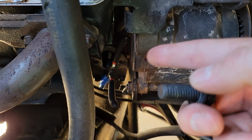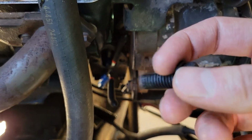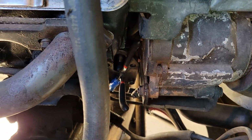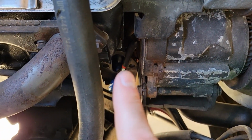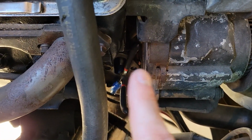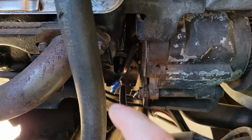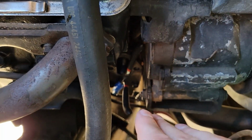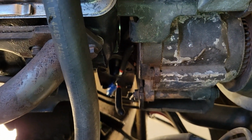It's really just best when your engine is out, which it naturally isn't in my case. The other tips and tricks you can do is they talk about putting a heavy grease on it, so you'll be able to push the rod and that'll slow the descent enough for you to go ahead and put your fuel pump in place.